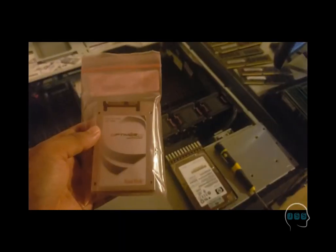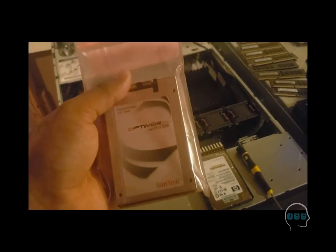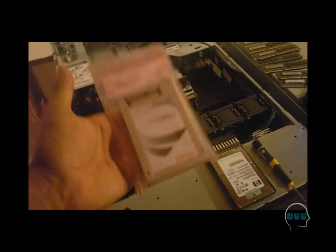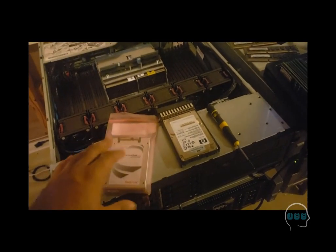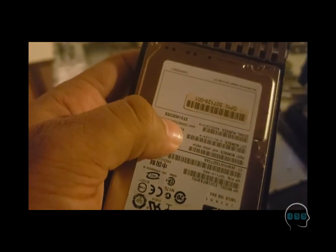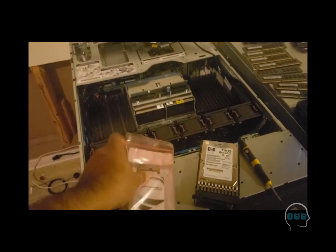We need to beef up our server, so you will need to invest some money to make sure your server is great for virtualization. Our members can buy access directly from us through our community portal where we provide access to VMware servers in our labs for 30 days. But if you do want your own, this server is 24 cores but the hard drives that come with it are really small — only about 125 GB. We're replacing that with a 2 TB 10K SAS enterprise-grade drive.